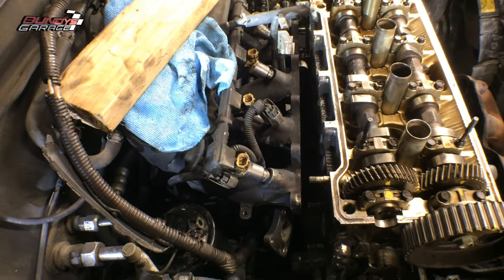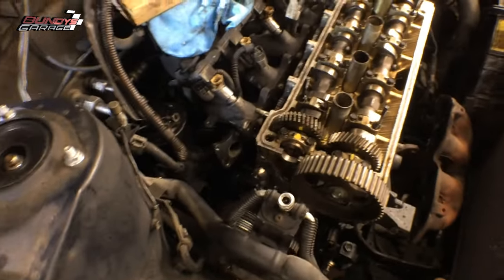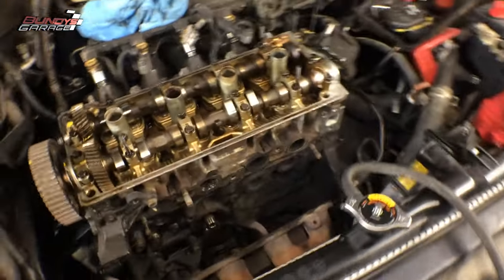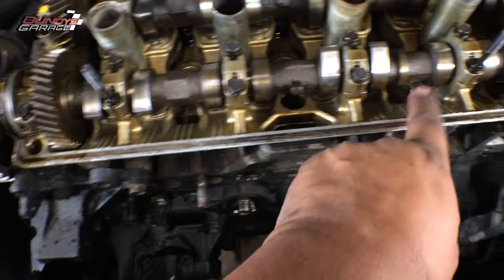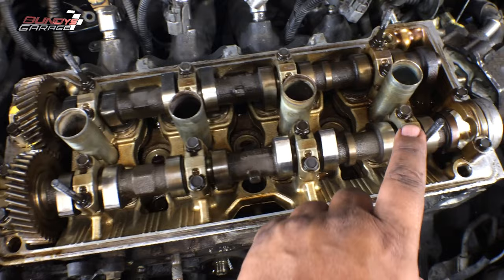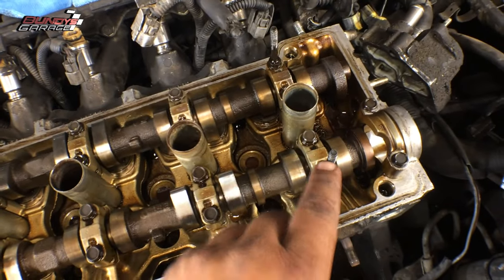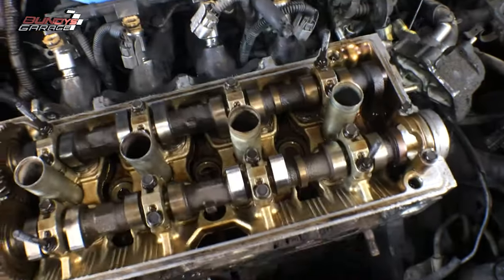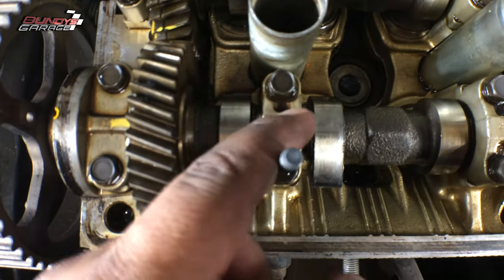This wasn't too hard, but it was a little bit more difficult than I thought, just reaching underneath. The top bolts and top nuts are pretty easy to get to; it's the bottom ones that are relatively hard. There's also a 45-degree bracket that goes from the intake to the engine block itself, held on by two 12-millimeter bolts. I just took it off towards the bottom of the bracket, and to get to that bracket you actually have to go underneath the vehicle.